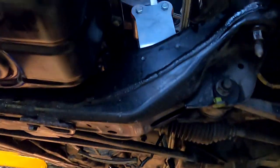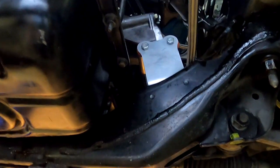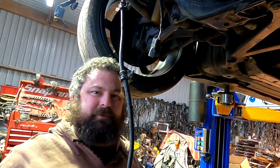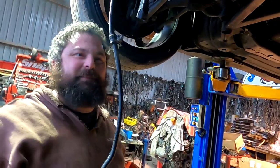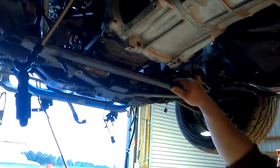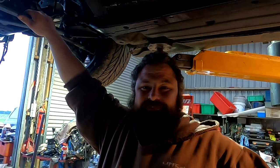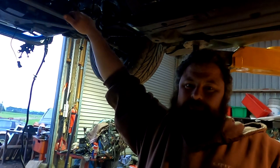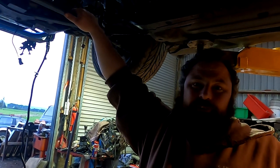The dog got out. The engine mounts are fitted solid - the motor isn't moving but more vibrations will come through the car. The turbo is close to the strut tower. There's some holes there - just move it back, job done, bolts straight in. The wiring loom fits, though it's a bit tight around the back of the manifold with all the fuel lines. It has a little bit of extra length in it.